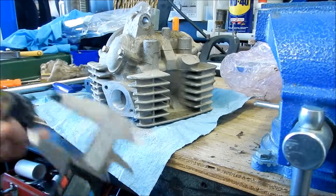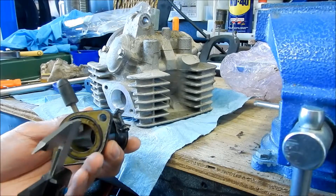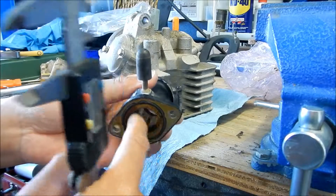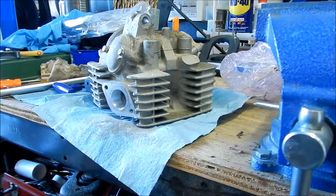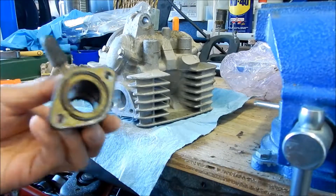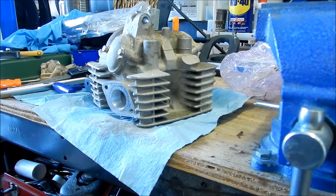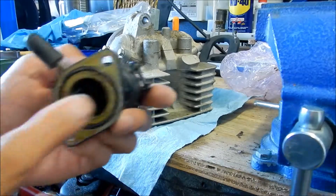That's pretty much where we want to stop because the intake manifold I just measured is almost 25. We're pretty close. What I might do is open this up just a little bit on the tip - just enough to get an extra half millimeter - and then pretty much everything will be matching. It's okay to have a smaller hole flowing into a bigger hole. The pipe here is about 24, so everything is pretty close - we're talking less than a millimeter clearance. We're going to grind the outer part to maybe 25.5.